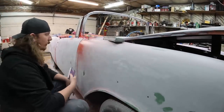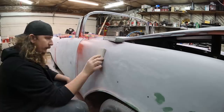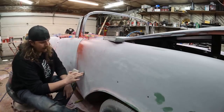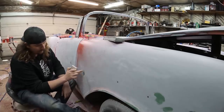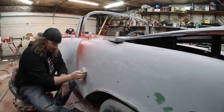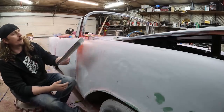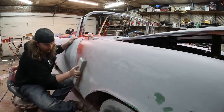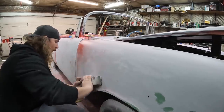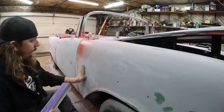On this section of Dan Butcher's bodywork, I'll show you what I'm doing. We're going to use a small block — I've got 180 on this. I want to dock off a little bit of filler that I put on just on the pinholes. Bear in mind, this is just going to go a little scrape or something like that — we're not trying to flatten this out at this point, we're just filling in a little hole or crack. I kind of want to get it off here real quick. Probably creating a divot and screwing it all up. Once we've got kind of the gist of it off, we'll take the long board with 220 on it and hit it back and forth — this will kind of flatten her all out. We'll have the divot out of it.